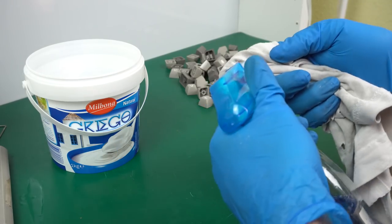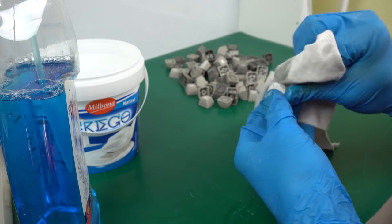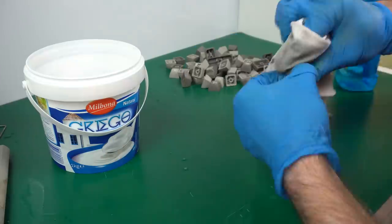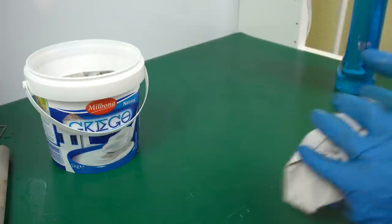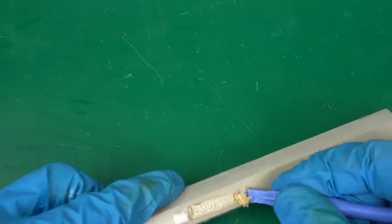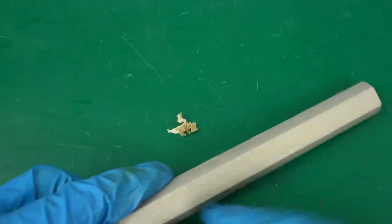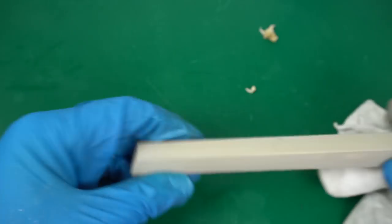For the rest of the keys, I'll apply some window cleaner to keep the rag wet and scrub all five sides of each key. They're not too dirty, so this should be relatively straightforward. Another 80 more to go. Let's see if the space key is better now after sitting with the oil — oh yeah, look at that, it just comes right off. That's a good trick. I used to use alcohol for things like this, but it takes more effort to soak in, and the alcohol can damage some plastic surfaces. This oil method is great.